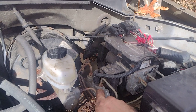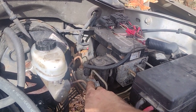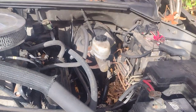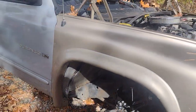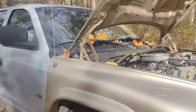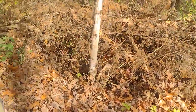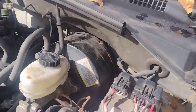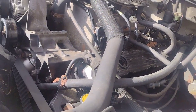You've got to keep your disc-to-drum proportioning valve - definitely keeping that. You can see this booster - it's got to go, it's all starting to rot out and scale underneath there. This thing is just falling apart, it's junk really. But we're trying to do everything we can to keep it on the road because I'm just a shade tree guy and I don't want a car payment - I'd rather fix this. We'll get rid of all this mess under here, replace the booster, go through the vacuum lines, and get it a little more straightened up.